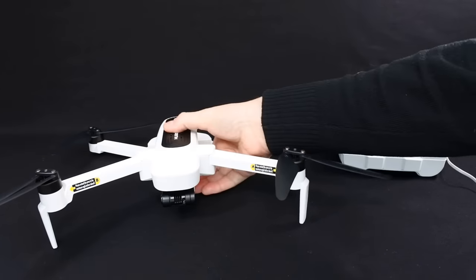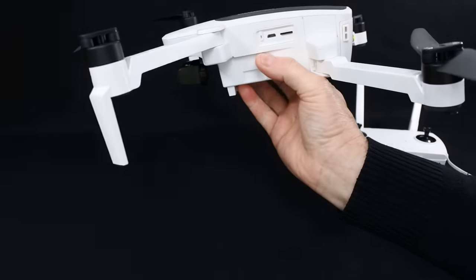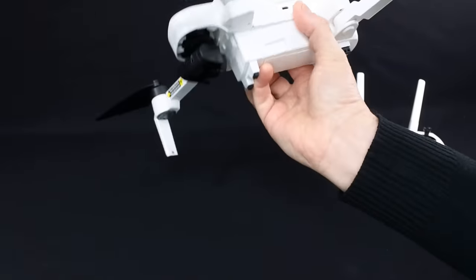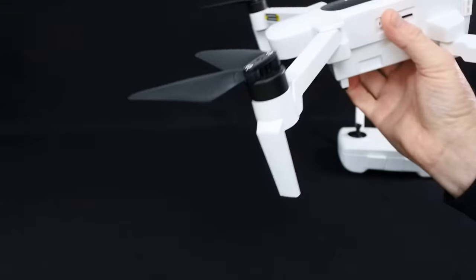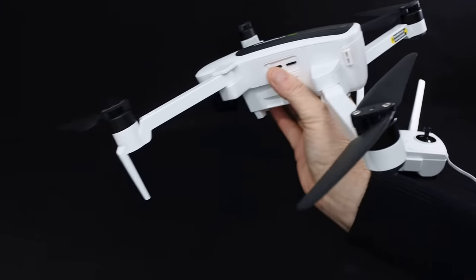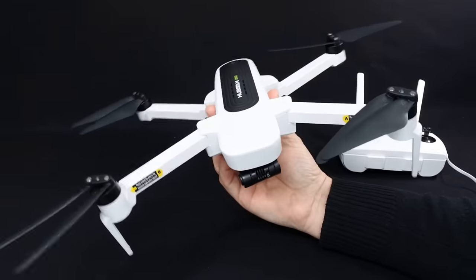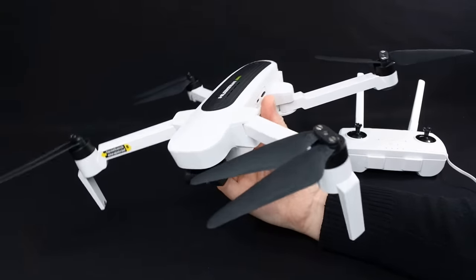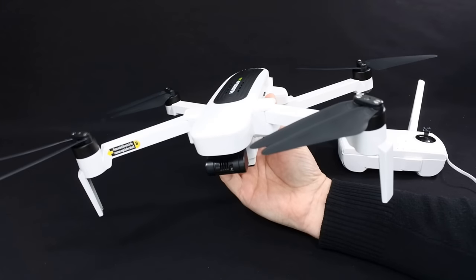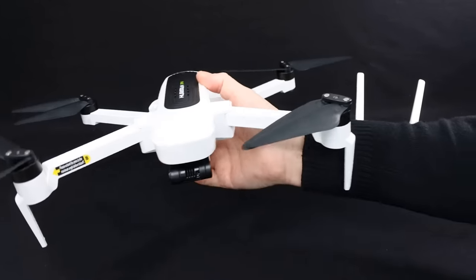By that, what I mean is it'll hover nicely in the air. Its hovering's actually not that bad at all. There's a little bit of up and down movement because it's got no sensors. But when you fly this and you want to do a turn and you let off the sticks, this is going to wander. And it's exactly what the 501 SS did. This is what it'll do for a couple of seconds until it finds its GPS lock again. Not a fault with the drone, it's just how it is. It's just what the GPS system's like on it.